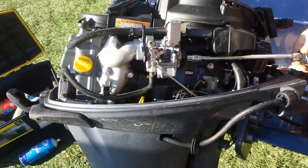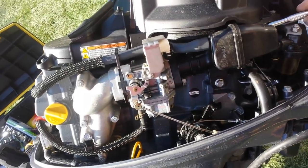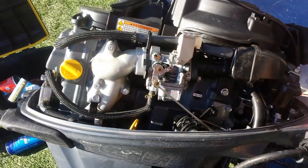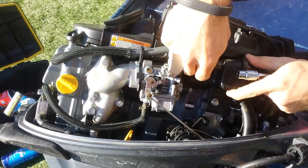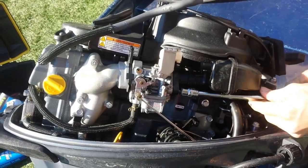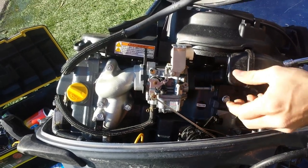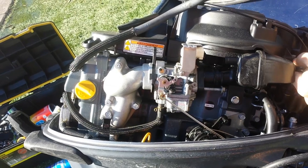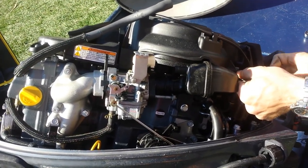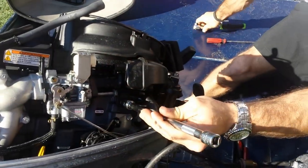Start with the 10 millimeter here. Take these two little nuts free. You can disconnect the throttle linkage right here just by popping up this little plastic nub — pop that out. There's no choke linkage; it's electronic. Take the crankcase breather hose off — it just slides out. That is for positive crankcase ventilation, where blow-by gets past your pistons into your crankcase and is fed back into the intake to get burnt up, giving you lower emissions. The wobble extension comes into play because it's kind of tight on these motors. Also got another little 10 millimeter bolt here that holds our intake manifold on.